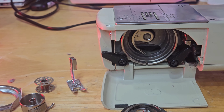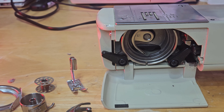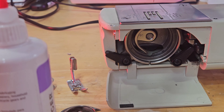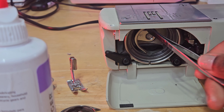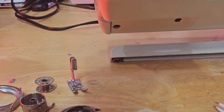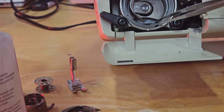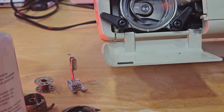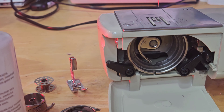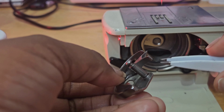Now we're going to do the oil — I almost forgot! This is Singer all-purpose machine oil. This is a Kenmore, so we're going to put some oil right here on the shuttle race — this area right here. I'm just going to lean the machine back and drop one drop of oil right in that area. Then I'm going to give it a little swoosh, and then I'm going to put some oil right here on the pin.